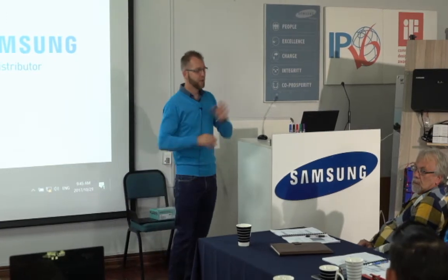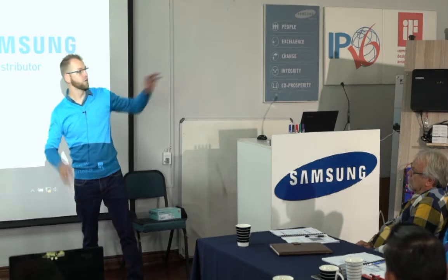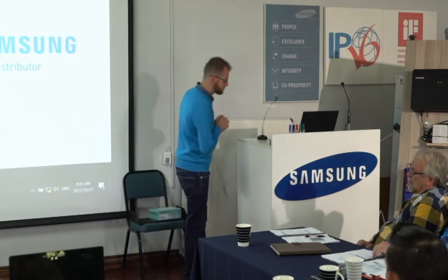Okay. You guys happy with the MikroTik setup? If it's a failover device, for an example, two MikroTiks or one MikroTik, the setup stays the same. The only difference is if it's a standalone MikroTik, you have DHCP. If it's a failover, there's no DHCP on the SXT MikroTik itself. Okay. You guys happy with that?